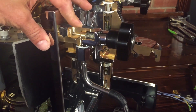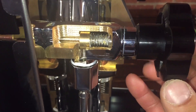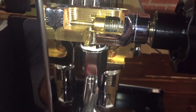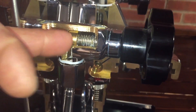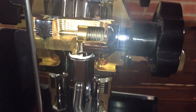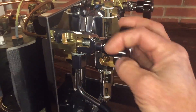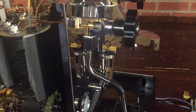Over here we have steam valves — we call them sprung steam valves. These are really nice because they have springs in them. The knob has no pressure on it at rest; when you turn it back, it pulls on a shaft which pulls the valve back, opening a line for steam to come through down to your steam wand. When you close it, the spring tension pushes the valve closed. You're not cranking down and ruining the valve seat, they last a really long time, and it's a short throw — less than half a turn of the knob for fully open to fully closed. Commercial-style valve.